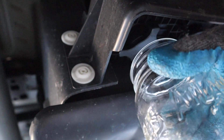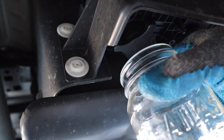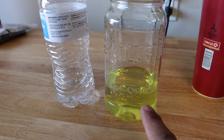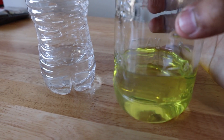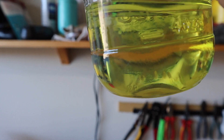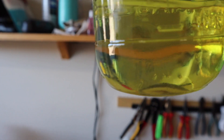I'm going to go ahead and use my second hand to drain a little bit — maybe about a quarter to a half — to see if there's any water in the water-fuel separator. Here is the fuel drained out. Here's the color of water, here's the color of diesel — it should be a slight yellow tint. You would absolutely know if there's water in the diesel because it would look abnormal, like a white fluffy separate element within the fuel. It would be heavier, so it'd sit at the bottom while the fuel sits right on top.